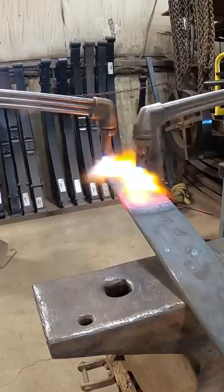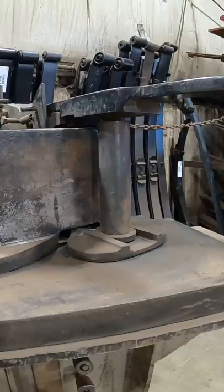Today we're going to be rolling some downturned eyes. It's a little backwards from what we normally roll on most vehicles, but this is how we do it. We're first going to heat up the steel and get it red-hot, and then we'll stick it in our machine and give it a roll.